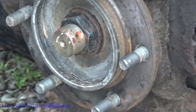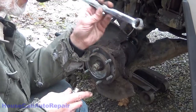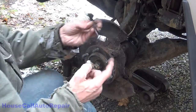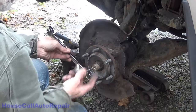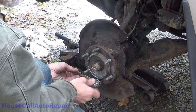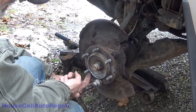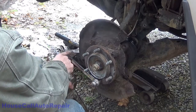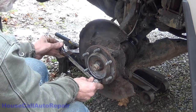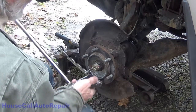This is supposed to be a 35mm bolt. What we're going to do is use a 22mm wrench and one of the lug nuts — put the wrench in a curved facing bend — and screw a lug nut on. Then we're going to pry it against this stud right here and set it on top of the jack stand, as far out as we can for best leverage, then back a little bit to keep it snug.